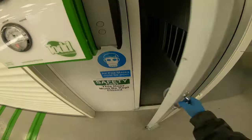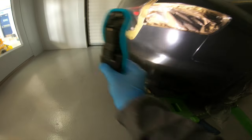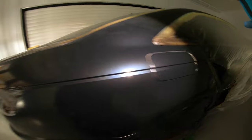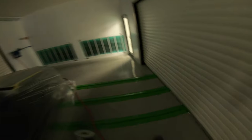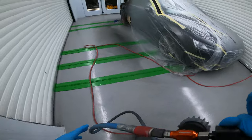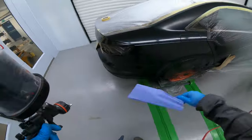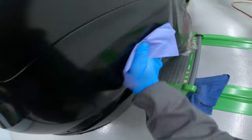Now you can see here I'm just turning off the lights and going in with my torch just to check. Coming from Glacier, which is a two-coat system and then a drop coat, you want to make sure you've got coverage. The worst thing is to send the car out and find it's not quite covered. I'm just using my ring torch — I'll put a link in the description. These are really good, CRI 95 plus, which is ideal for color matching. I'm just a little bit unhappy with that lower part of the quarter panel, so I will apply an extra coat. There's some dirt on the bottom there — tack cloth.